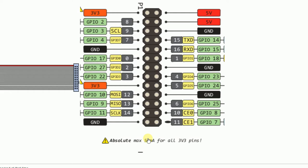This is the pinout diagram for the Raspberry Pi Model B. You can use any Raspberry Pi for this hack — I'm just using one of the cheapest and oldest versions dedicated for this task. We're going to use GPIO 17, also known as P0, and GPIO 18, also known as P1, for our relay. We also need to grab one of the 5-volt pins for powering the board and one of the ground pins. That's all we need for GPIO.